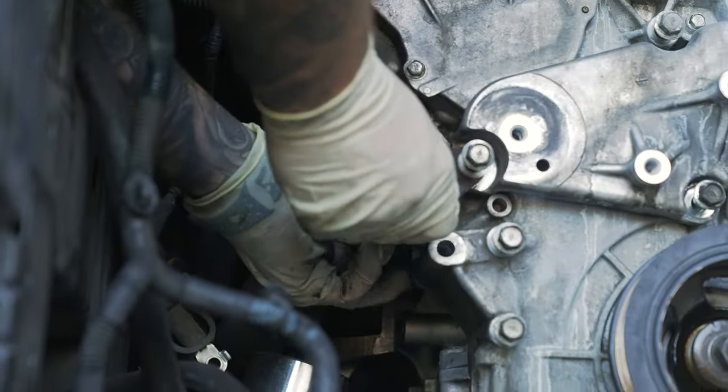Since the water pump is on, water pump and guide gasket — everything's done. We're going to knock out the thermostat right now. Pull that out — just a few 10mils on there, two on the sides, one on the bottom. Since we did the water pump first, not too much coolant should come out. Doesn't look horrible, so I'm just going to go through here and wipe this cover, get any residue off of it, and make sure we got a good seal on the new one.